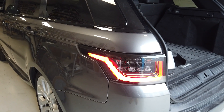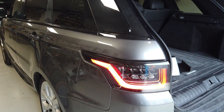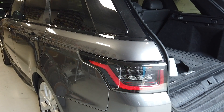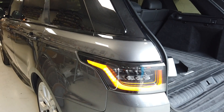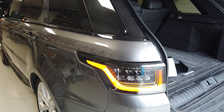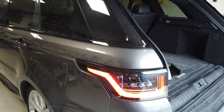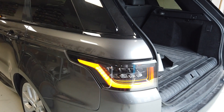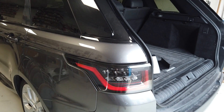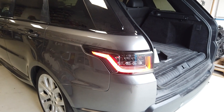Right, let's see — unlock and you saw that do everything right. Now put your hazards on, put your side lights on, now turn your indicator off. There we go — that's the retrofit, that's the fix to turn the tail light off when you're indicating, and you get a much clearer visibility of the swoop. Good luck with that.